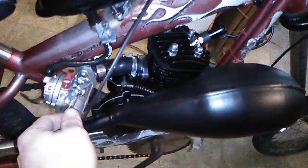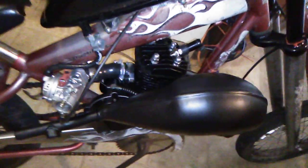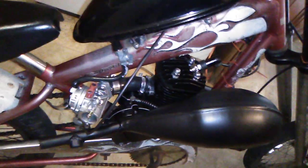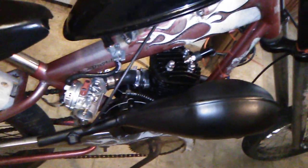I got the pipe on, pumper carburetor on. Took it for a ride. It's got a pretty good bit of power. Did a decent port job. The exhaust is probably around 170 degrees. I got the transfers flowing toward the intake real nice. I didn't raise them. I lowered the intake.